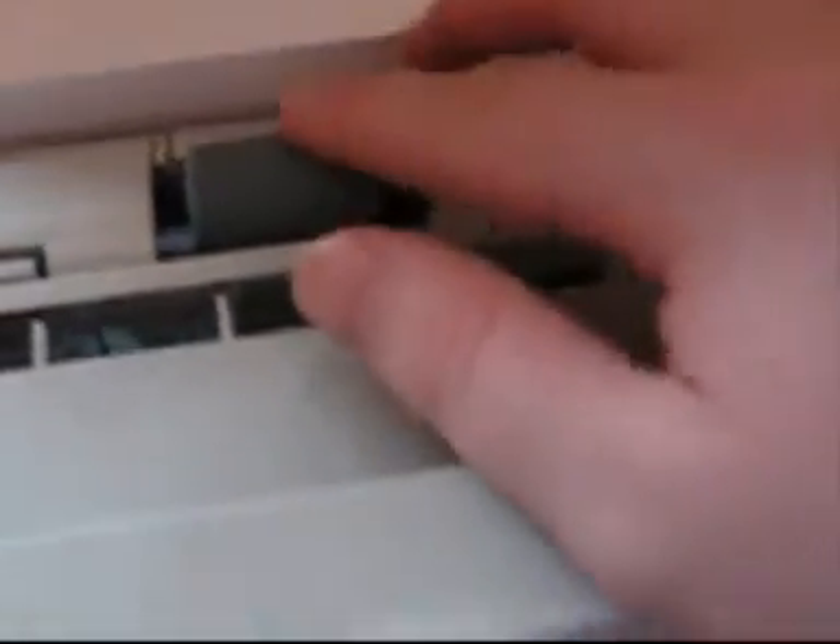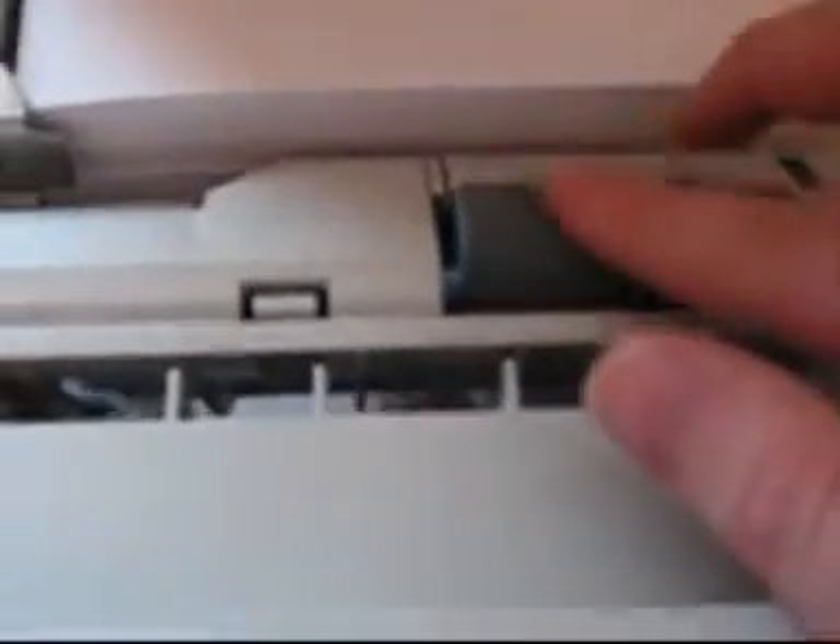It's picked up one page. Now what I need to do is dislodge it completely — like so. Let's say that the technician has not fitted the separation roller and the clutch properly, in a hurry like that, and the separation roller is jammed into this part here which accesses two components. Now, as you can see, it's printed normally even with it not being lodged properly.